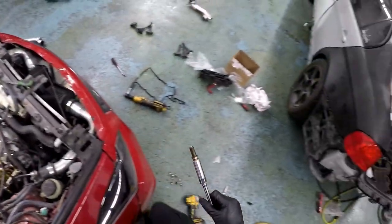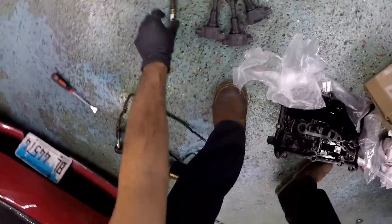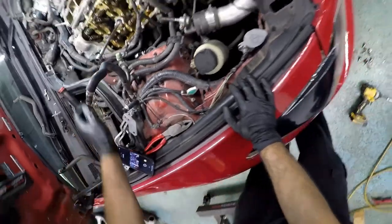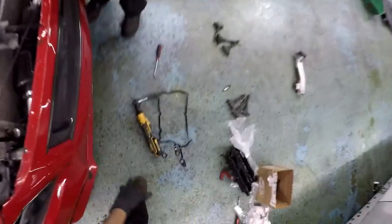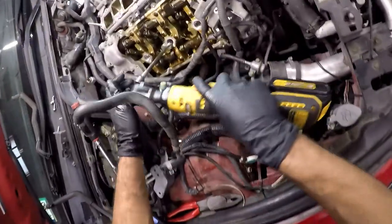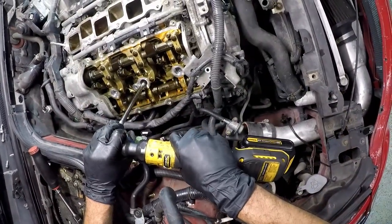This is full of oil — damn, crusty as hell too. Look at that. I had a feeling, going on those headers I was like, you know, I'm probably running rich, so they're probably going to be black. And then I already know I had the oil going on. Every time I was driving on sport or higher RPMs, you could smell the oil coming out more.